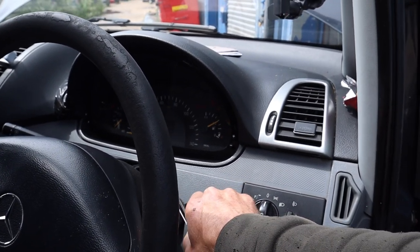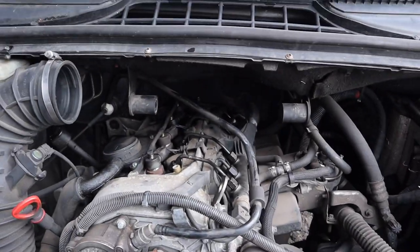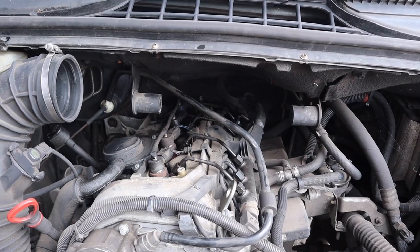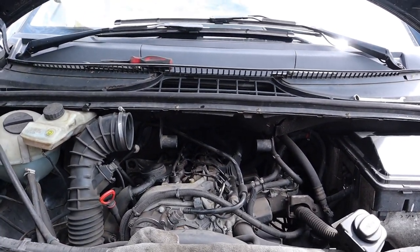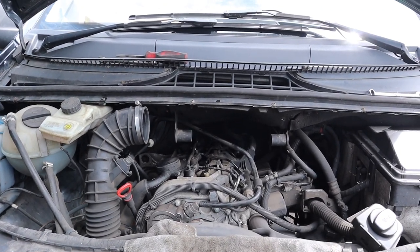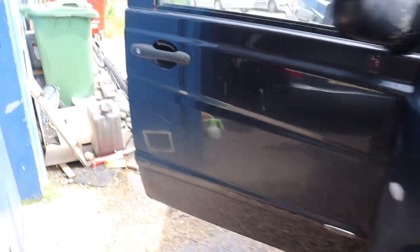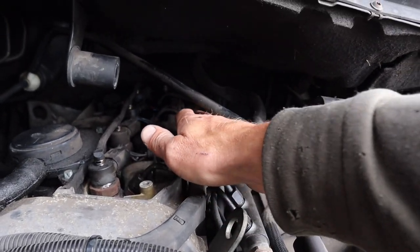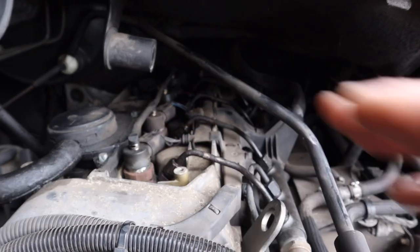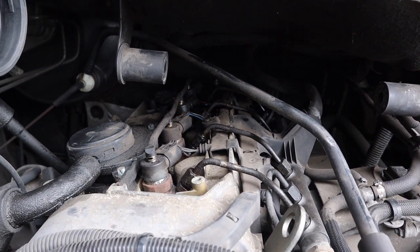I've let it run for a bit. I'll show you what I'm talking about. I've got the airbox stripped out already. It's the back one unfortunately on this one — it's a bit fiddly — but I'm going to do all four. What you want to do is get all four fuel lines off, take the return lines off, unplug the clips, and order four new washers and four new bolts. They are stretch bolts, so it's always good to get four new bolts.